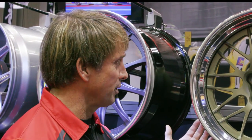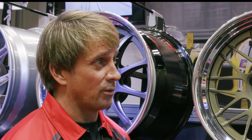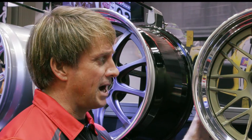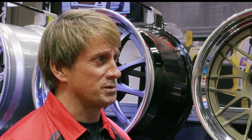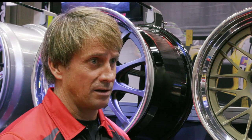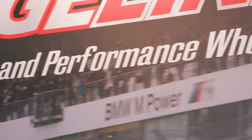When you put race tires on your car, you decrease the load rating of that wheel considerably — because they have more grip. The load rating on a wheel is based on a tire grip level of 0.7, but Super Sports tires can pull 1.2, which is almost twice as much. So you're almost cutting the load rating of that wheel in half. Our race wheels are load rated at 2,100 pounds, which is well over anything you'd be racing on.